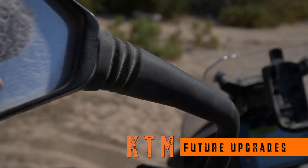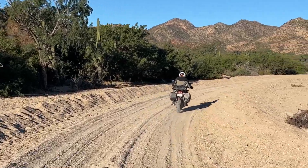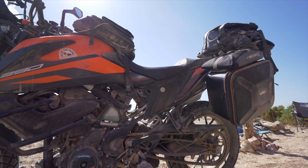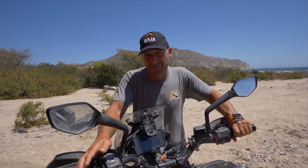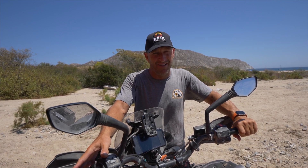Future plans for this bike: first, new mirrors — I want aftermarket ones that don't spin and bounce around off-road, because you really need your mirrors. Second, more aggressive tires that I can still use on pavement but that perform better off-road. Third, I'm looking at changing the front sprocket to get some lower-end power and ride the bike slower, because anything under about six miles an hour gets very jumpy with the current gearing — you really have to work the clutch quite a bit.